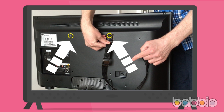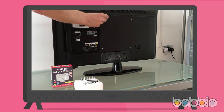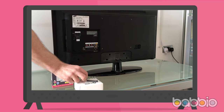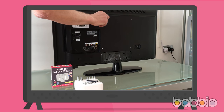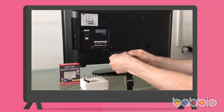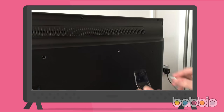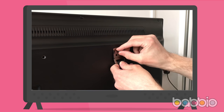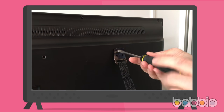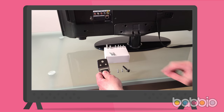Choose the mounting holes you'll be using. As a minimum, you should install at least two straps per TV, to the left and right of center. Take the 28-piece screw and bolt kit out of the box and select the flat-ended bolt that fits into your TV mounting hole — we've included all common sizes for industry-standard VESA-compliant TVs. If required, use the round washer with a smaller bolt to prevent it falling through the large hole of the end plate. Using a screwdriver, attach the strap end to the TV using the largest of the three holes — no need to over-tighten, just ensure the strap end is secure.